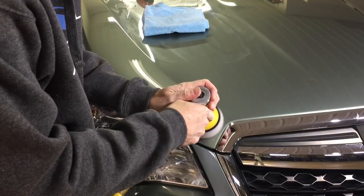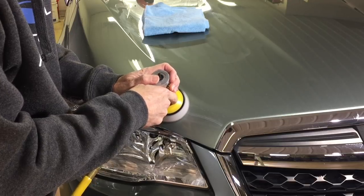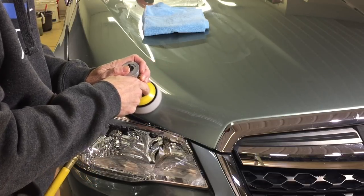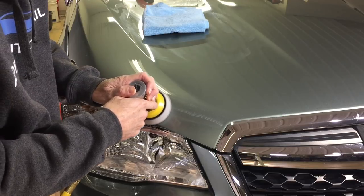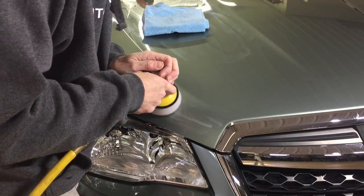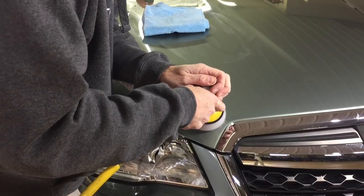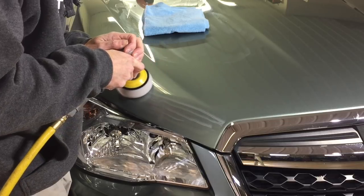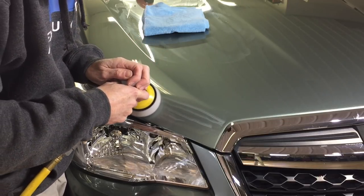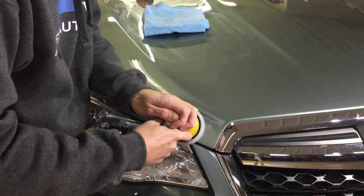You're going to do some very quick, very effective cutting. With this kind of power from a pneumatic polisher — or a rotary teamed up with this pad, which has extra cut to it — you've got to keep the tool moving with nice, steady movement. No pressure is needed.